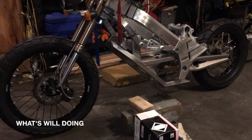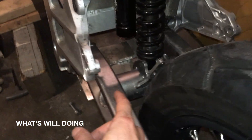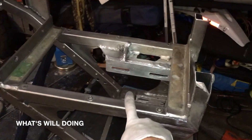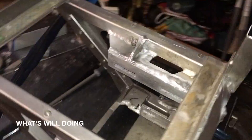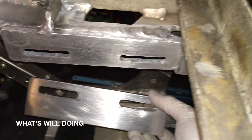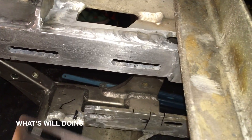It's starting to look like a motorcycle again. The width of this frame is about ten and a half inches wide and I just had to trim a little bit of casting off of the frame. Then the zero frame just kind of slid right in there more or less, with a little bit of filing and a little bit of grinding. What I've been working on is welding the motor mounts into this zero frame. The motor I'm going to use is not the stock motor that came with this, so the holes are not right. So I welded this motor mount on here. All I've got left now is I've got to weld on the lower tab right down here, so now you've got the four slotted holes for the four mounting bolts on the motor.